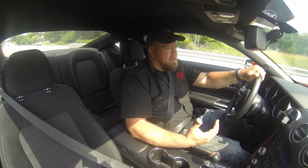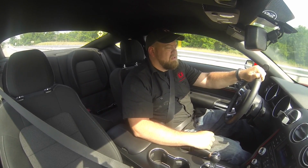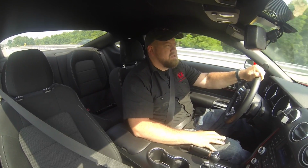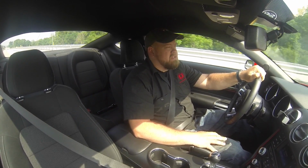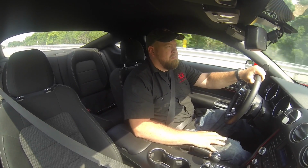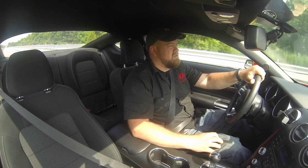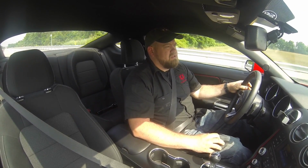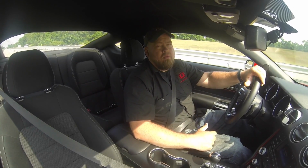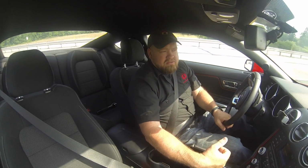Here we are again on the highway, get up to speed, merging. 65 miles an hour. As soon as it goes into high gear, you can barely hear that it's even back there. There's no drone to it. We're right at 2,000 RPM, which would be the worst case. Like I said, you can barely even hear the exhaust. And this is with an automatic, which does tend to drone a little bit more than the stick shift cars do. And again, no problems.